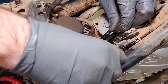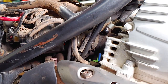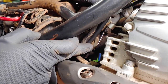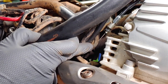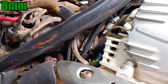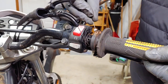I set the adjuster in the upper cable as loose as possible and secured the locking nut. When I pulled on the opposite end of the return cable, the housing slipped right into place. The return cable doesn't have any kind of free play adjustment — it just needs to be tight on the mounting bracket. Now the cables can be connected to the throttle grip as shown. I tried attaching them to the hand grip first, but there wasn't enough slack to connect the other ends.